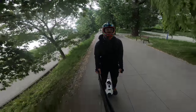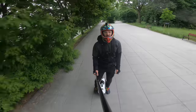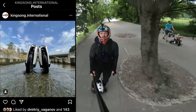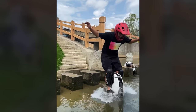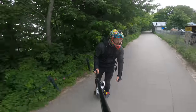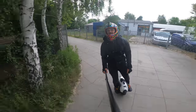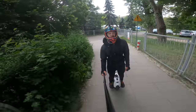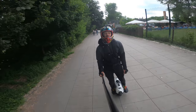The KingSong S18 is quite different — it has a nice exoskeleton and the batteries have a plastic housing, making them much safer than on the 16X. The S18 is totally safe to ride in rain; KingSong even posted a video of it driving through puddles and small rivers. I've also ridden the 18XL and 18L quite extensively. Same advice as the 16X: put a plastic bag on top when riding in rain. The trolley handle might affect the lift switch, but the 18XL is a pretty safe wheel in terms of rain use.